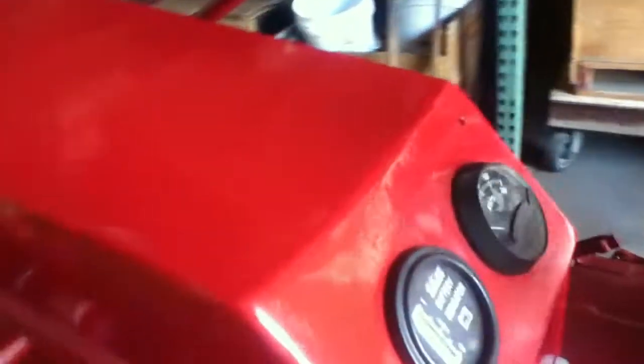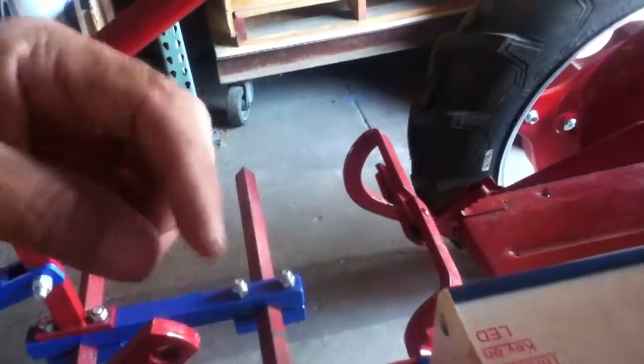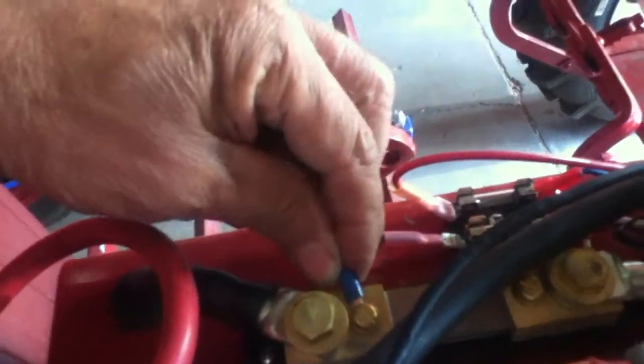The gauges are in the lid here. There's the amp meter and the battery level indicator here. They run through fuses — this one runs through a fuse over here. This one measures the amperage that you're pulling, and it runs back to the gauge here. I like these little glass fuses just because it makes it very plain what comes in and what goes out, and you can see everything and follow it. We've got two over here and two over here.